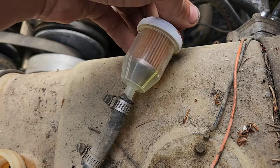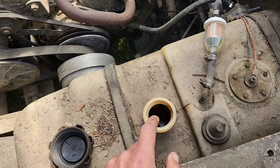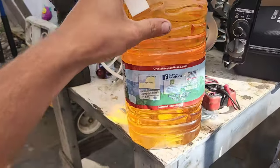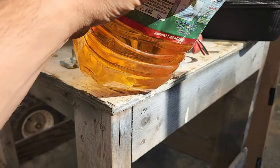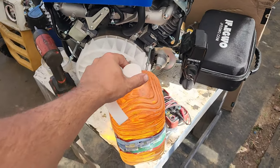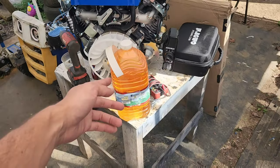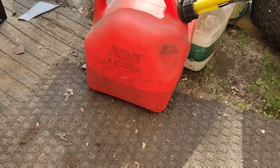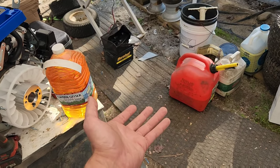It's a weird yellowish green color to the bottom of it. I think we're going to siphon this gas out and start with fresh, known good gas. This is the apple juice that came out - it's got a little bit of diffused water in the bottom, but it's really not that bad. I did a burn test and it seemed to burn off fine. My bet is it's probably that color from having some Sta-Bil or something put in it. So we're going to burn that through the gas-powered power wheel - there's about three gallons of free gas.